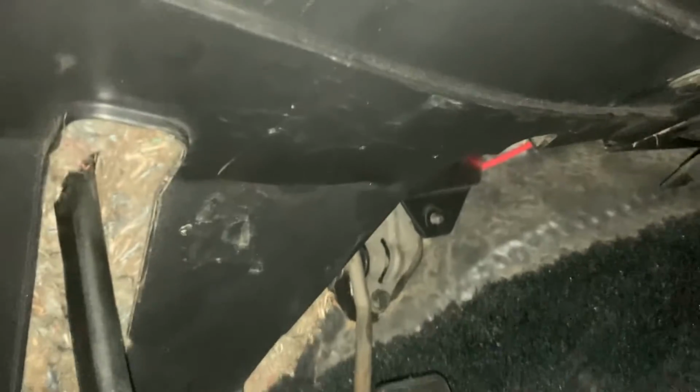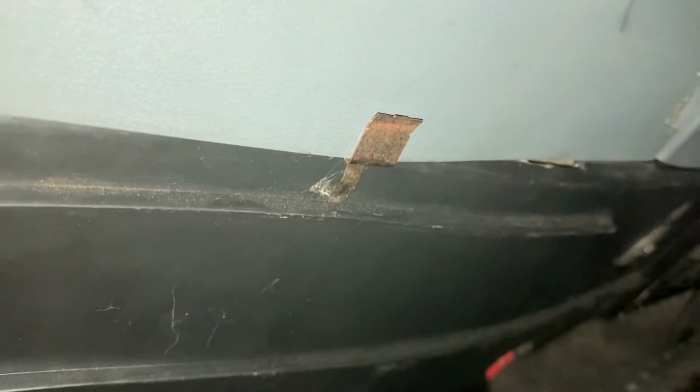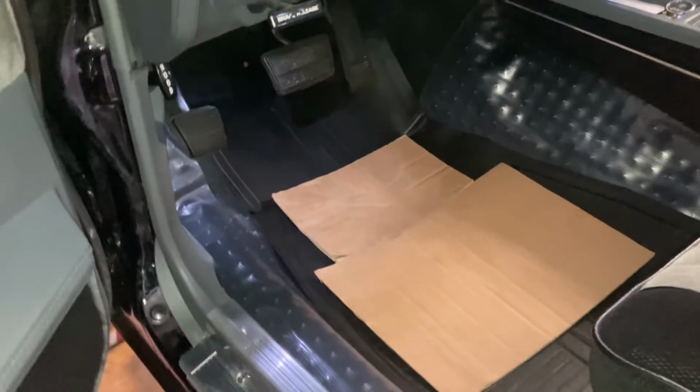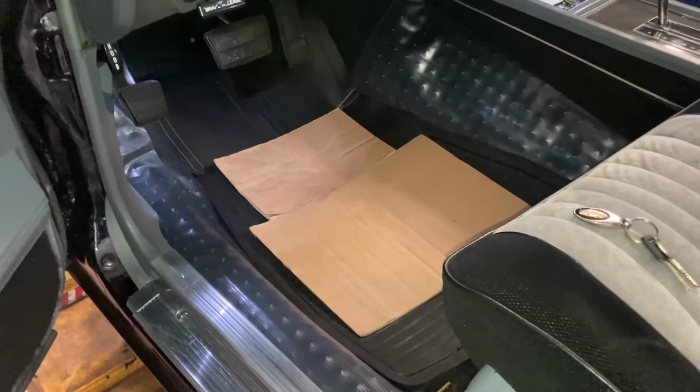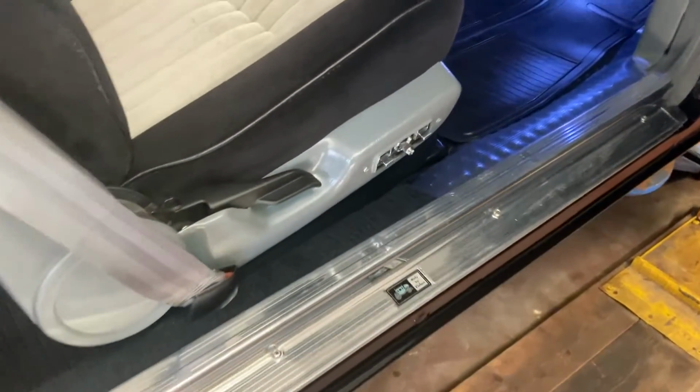One little thing here, back in the dealership days, you know these clips, you've seen them for your dash panels. Well, what I used to do is I'd pull the little foot of one of those clips off. You got a million of them, don't you, in your drawer? Stake it on there to hold that hush panel up in the center. I often wondered what would happen if I submitted that idea as a line change. You know how you get $10 or something, or back in the old days, if you thought of something to make things more expeditious. I don't know. It always worked for me, and yeah, I don't know what else to say.